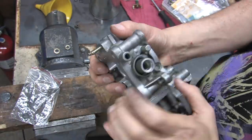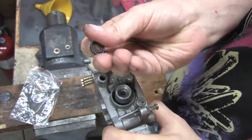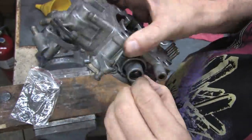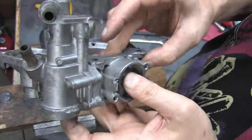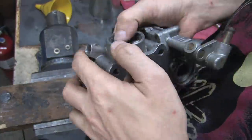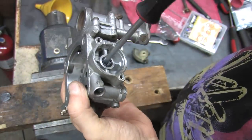I'm installing these seals by hand, dry, exactly like I showed you on the 91 to 94 throttle body. They're the same seals, it's supposed to be the same hole. But the linkage side was really easy to get in, and you'll find that this TPS side is tighter than all of the other throttle bodies if you rebuild all of them. You'll fight with this one for a bit. I had to start over 3 different times before it cooperated, and it was me every time, but there's a noticeable difference on both sides of this one, unlike the 91 to 94.